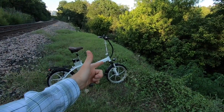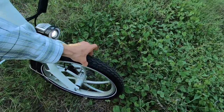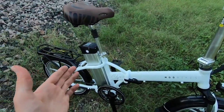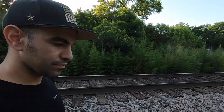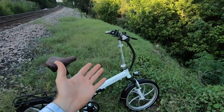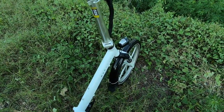That weight comes back to the fact that it has a suspension fork — this is an RST with 50 millimeters of travel. It definitely adds some comfort. These are larger, fatter hybrid tires, 20 by 2.125. We've got the cast rims that adds a little bit of weight, plus this enormous battery pack — 48 volts, 12 amp hours — that's like 9.8 pounds right there just for the battery. The battery is positioned right at the center of the frame, so it's still pretty balanced. The bike is commuter-ready with plastic fenders and mud flaps, which don't crack if bumped.